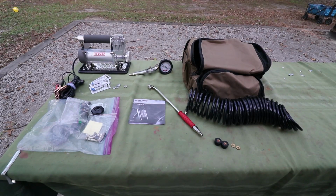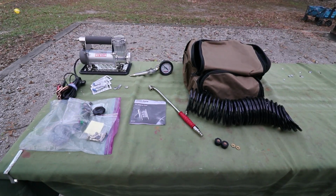We've taken the opportunity to set up all our tire pressure monitoring system and all that kind of stuff. I will remember this time to put the tire pressure monitoring system and the air compressor that we use down below. We went ahead and replaced all the batteries because we were getting some funky readings, and we equalized the pressure on all the tires, and this is our equipment that we use for all this stuff. That's the nitty-gritty of this day. It's basically been getting ready to go boondocking, and that's when we'll see you guys next time.